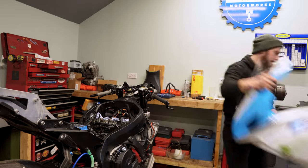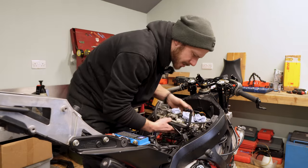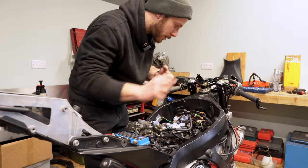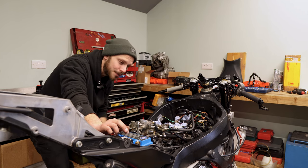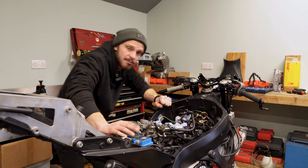While doing these valve clearances, rather than pulling everything directly out of the way, I'm going to move these throttle bodies — twist them slightly out of the way — just so I can keep the rails connected and slide the rocker cover out this way. You can get it out to the front, but it's more effort draining and re-bleeding the cooling system than it is to remove the intake and a load of plugs and looms, so I'm going to do it this way.